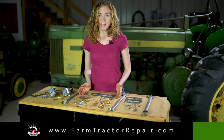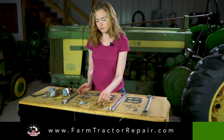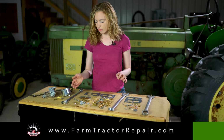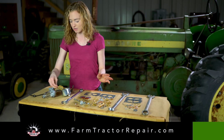All these parts come in the comprehensive kit, but don't be intimidated by them because we're going to show you how to put every single part in. You get new emulsion tubes. This is your adjustment for your fuel. These are worn out a lot. We got a new gasket here, or filter here at the bottom, all new gaskets. We got new soft plugs. Here we have the choke and throttle shafts that are brand new, new needle and seat, gaskets. Everything is included in this comprehensive kit except for the float. The float is a separate purchase, and you could buy this float even if you go the comprehensive route or if you go the economy route.